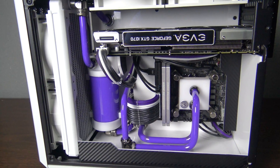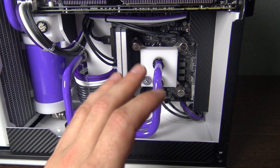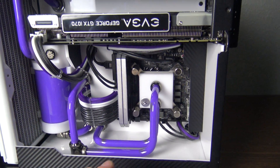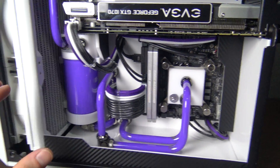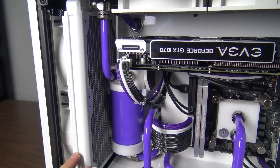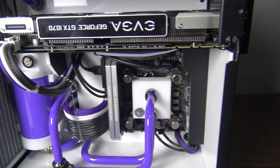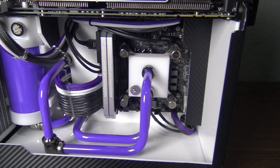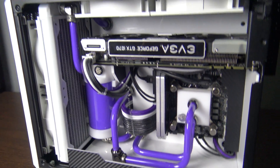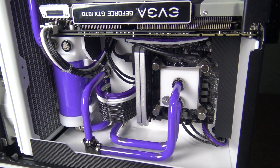I'll try to list them down in the description as well that I'm sure people are going to ask. It's a Gigabyte Z170 Wi-Fi board, 6700K, 16 gigs of Dominator Platinum, GTX 1070. I've got a Black Ice White Edition 30-millimeter thick 240-millimeter radiator. I've got the White Edition of the EK Vardar fans, White EK Supremacy Evo block, all Bitspower Black Sparkle fittings throughout. On the back side I do have EK fittings where I switch to soft tubing, but in front what you see is all Bitspower.